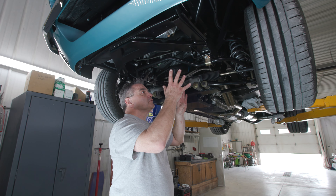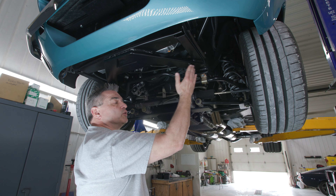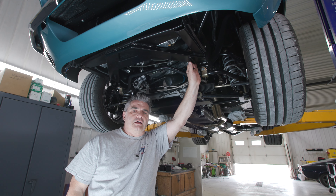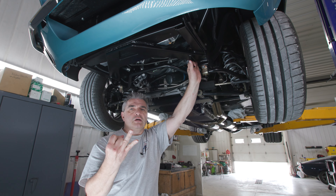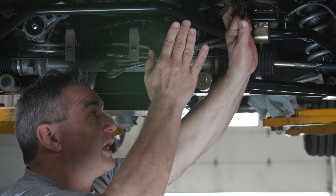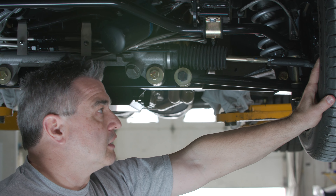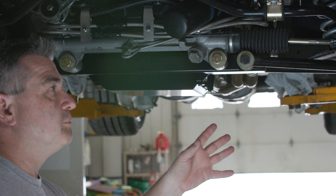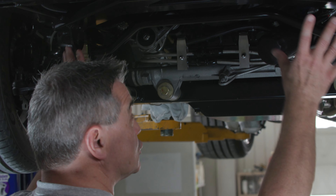With our long frame, the frame itself is actually a little bit wider than stock. The benefit to that is that it gives you more room for the headers, it gives you a much stronger, more firm ride because the wheels are outside a little more — a wider track than we would normally see with the stock frame. And thirdly, it just gives you additional strength.